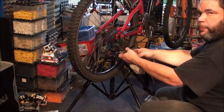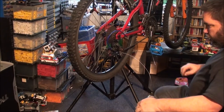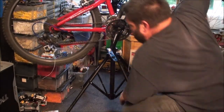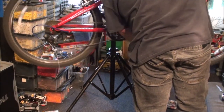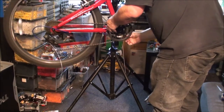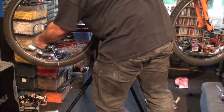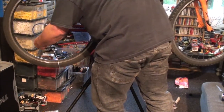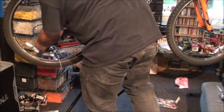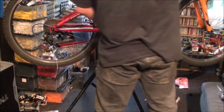So you start off in your bottom gear, 5th, 6th, 7th, 8th, whatever. I should mention that because I've forgotten. Bottom your cable down, and start shifting up, and watch your chain's right off at the front. So that wants to go in top, so I'm going to unscrew the adjuster a bit more. Like so. Okay.